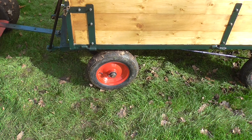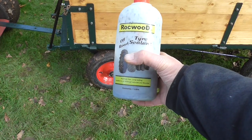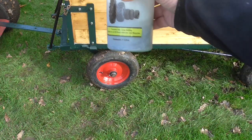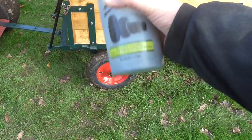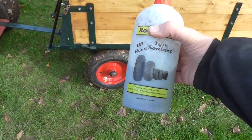This is what I normally use — the best thing is to take the valve out and pour this into the tire. It's a sort of gooey, slushy stuff that rolls about inside the tube, and any little holes where air is escaping, it rushes through with all this gunk and supposedly seals the hole up. It's worthwhile really, especially if you've got thorns about.